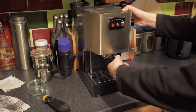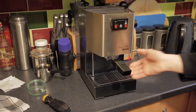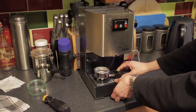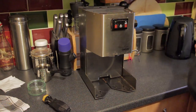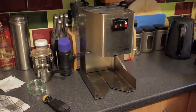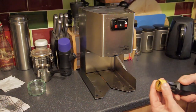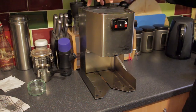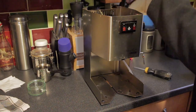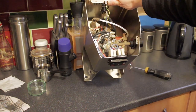The first thing we need to do is remove the plug, then remove the various components: the portafilter handle, waste pipe, drip tray - pop those aside. Pull out the water reservoir, making sure it's empty, and you can give that a clean out as well. Then we can access and remove the top plate. You'll need a crosshead screwdriver - there are four screws, two at the back behind the reservoir lid and two on the metal plate. With the four screws removed, the plate simply lifts away.